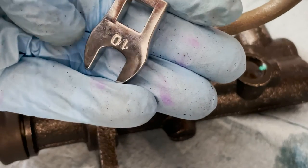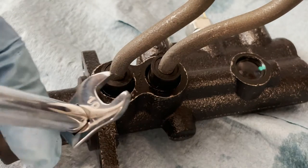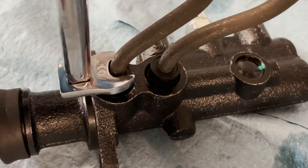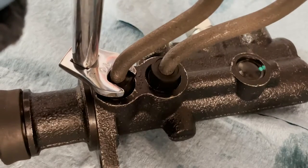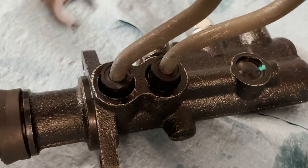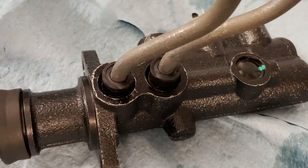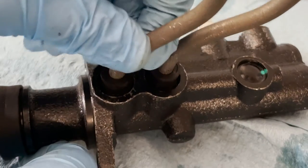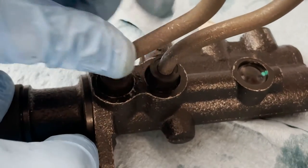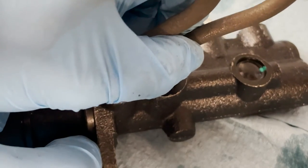I have a little crow's foot here and I'll put it on the end of a long extension and slip it around here, and then have some leverage to push down on these. Make sure they're really in. You can tell they're tight, and if you really wiggle these you can feel the metal on metal on the washer until you know they're definitely seated.